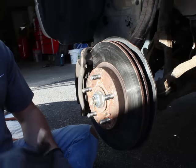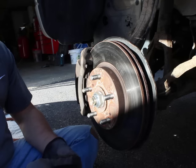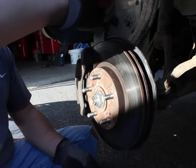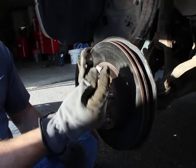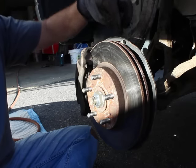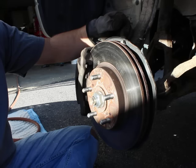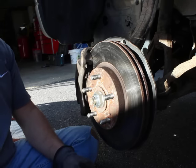It can go all the way down around the bottom as well, so try that to stop the noise. Here's another scenario: you drive down a dirt road or go over some freshly filled potholes and all of a sudden you get that scraping noise again as you're going down the road, only when your wheels are turning. What happens is a rock gets lodged between the plate and the rotor as it spins, making that grinding noise.